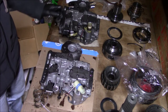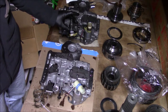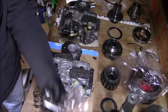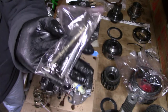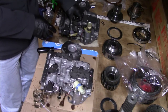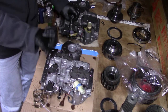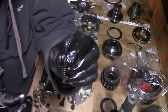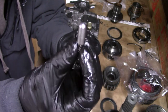All I need to do now is move the rooster comb from the old valve body onto the new valve body. I also have some new stuff from Garen associated with doing that. Since this detent ball is under spring pressure, I need to cover it so it doesn't go flying. This is the old detent ball and spring setup, and this is what's going in my built transmission — a little bullet instead.